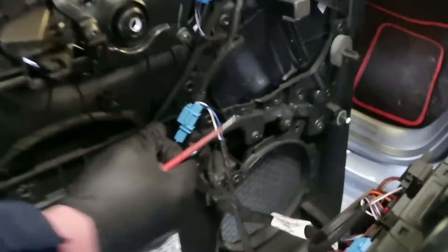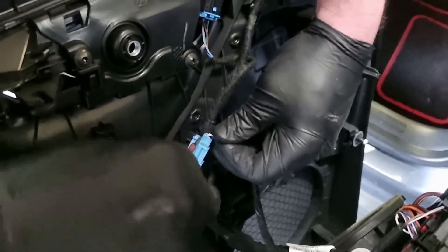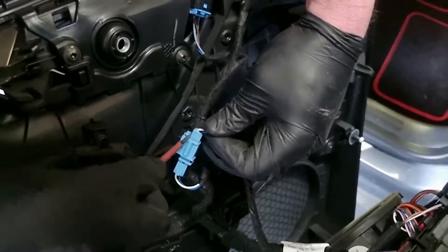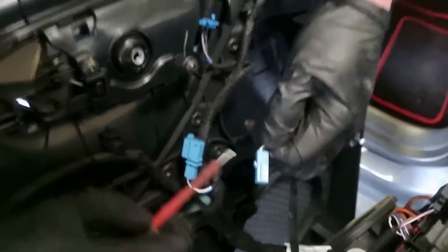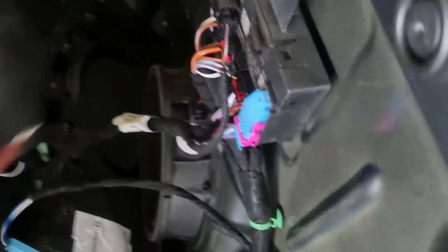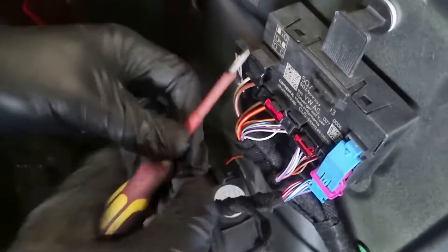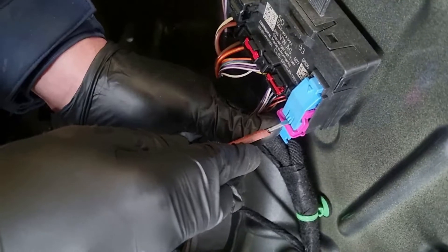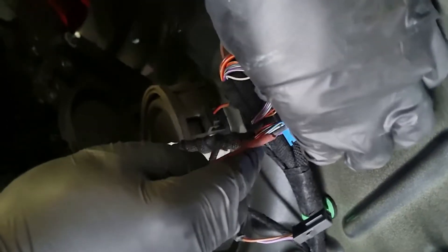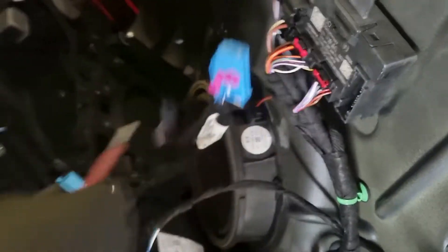After that it's electrical plugs. On the blue one and the other plug, the little tab at the end needs to lift up so you can pull the other side out — just pull it up enough to get it over that little notch. Further down on the door module there's another identical plug; pop the little tab up and pull it out. For the large plug, push the little tab in so you can swing the pink arm over — as you swing the arm over the plug will release.